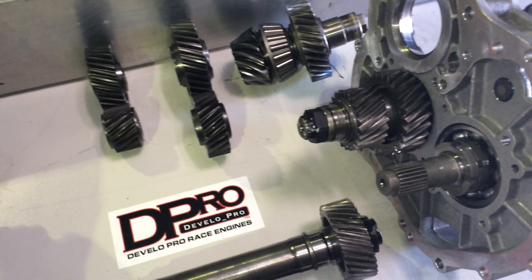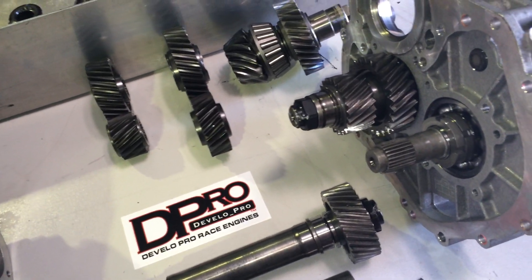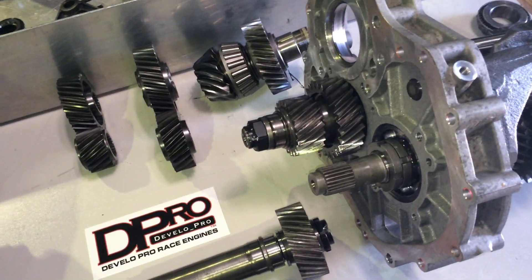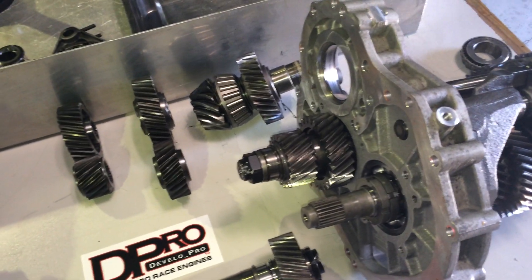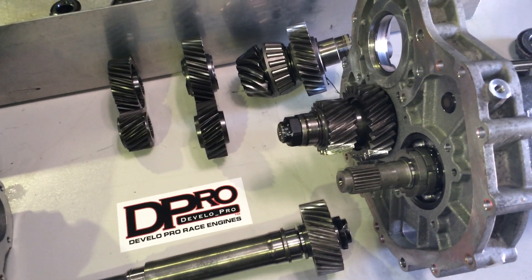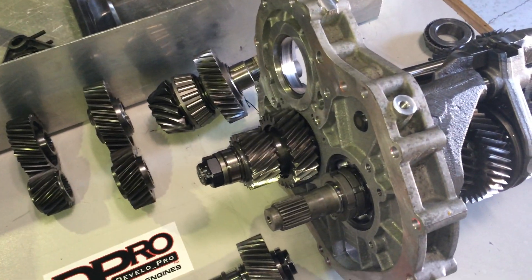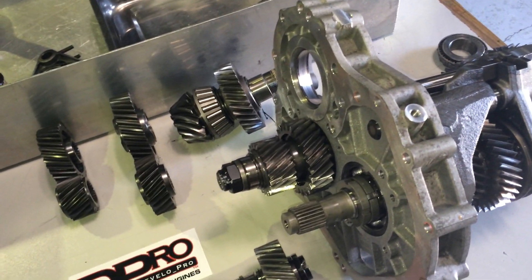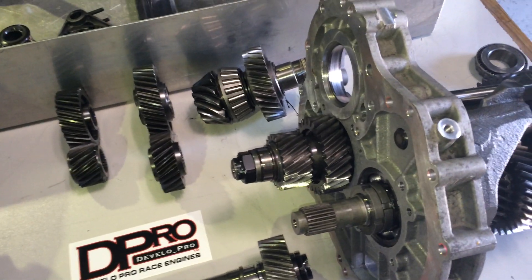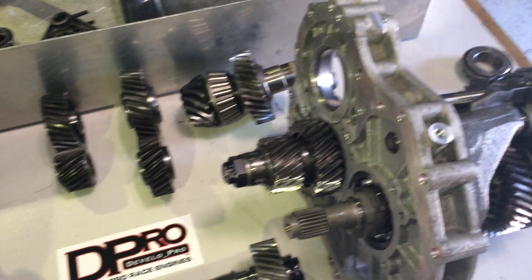So this is just to describe briefly how the system works, for those that are interested. Inside the Graziano 6-speed transaxle — found in pretty much everything from 2004 through to the LP560 5.2 litre where they changed a little bit — from 2004 through 2008 it's almost identical inside. First, second and third gear ratios in the Super Leggeras and other 2008 models had lower ratios as well.